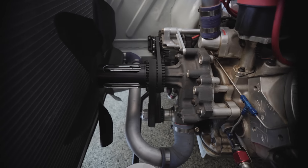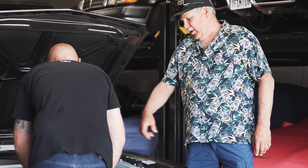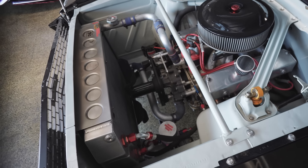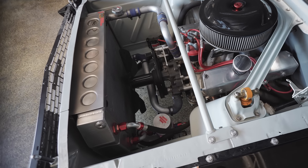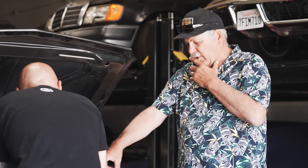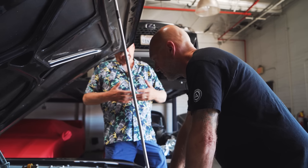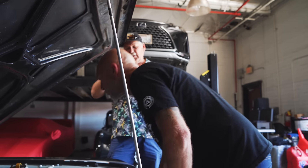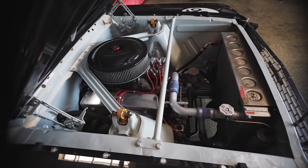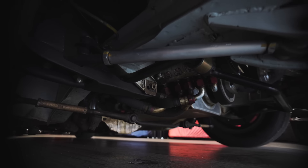You added the fan just for this week. You can see the spacer on it — that gives away how far back the engine is shoved. Just seeing the gap from the radiator to the engine gives you a real sense of how far it's set back. This motor is actually the second motor. The first was non-dry sump, and I could only push it back so far before the steering was rubbing the crankshaft — the oil pan was the limiting factor. With the dry sump, there's no deep pan — it's flatter.